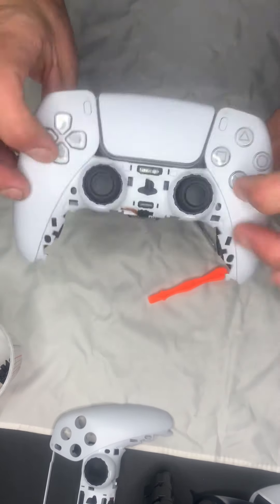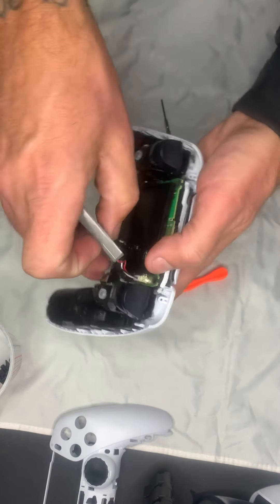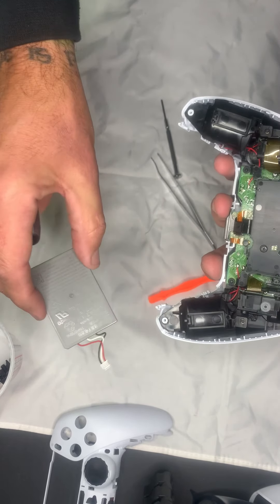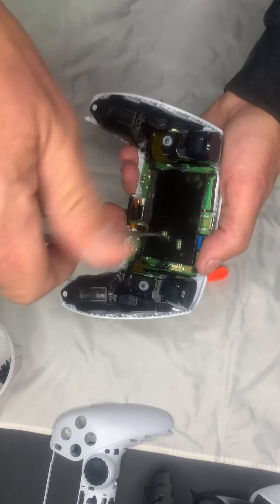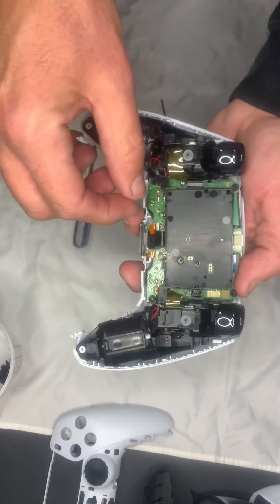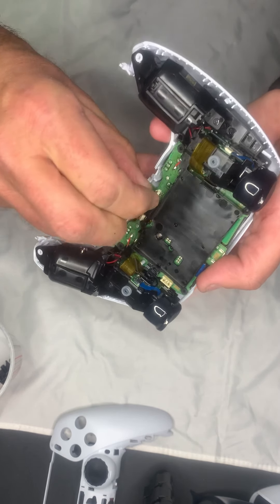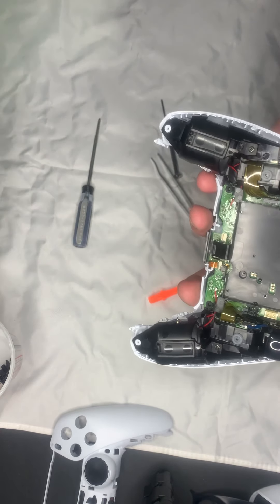Once we get in here you've got lots of stuff going on. We're going to pop the battery off first. Some people say to use needle nose pliers — I just personally wiggle them right off and I've never had an issue with that. Throw the battery to the side; it is a much bigger battery than in the PS4. There is a screw here, so we'll remove that first. Then you're going to come down here — there's a ribbon here for the microphone and speaker in the controller. We'll go ahead and pull that out; that is the speaker.